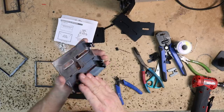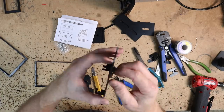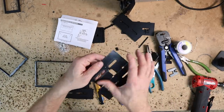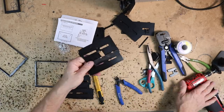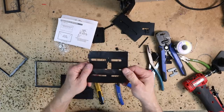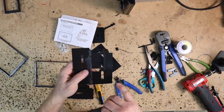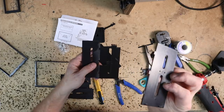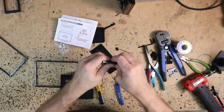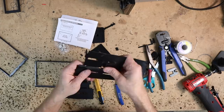Now the kit is all set. We're not doing a pocket so we can remove those pieces — they simply snap off. According to the diagram, we need to remove all the shaded area, which is all these in the back and the bottom half of this one. For any two-piece section, remove the part they're telling me to remove with flush cutters, bend it forward, and keep that little piece. The rest need to come off — the thicker ones a set of duck bills does the job, and for the more difficult ones switch to the grinder. Sand the area flat. On the inside, there's a line for a single din that has to come out — use duck bills, pull up, wobble back and forth.